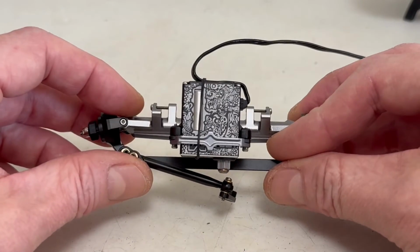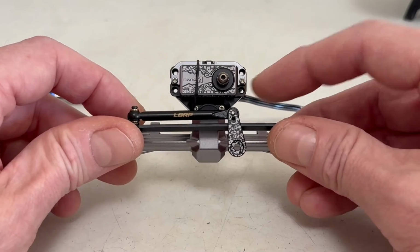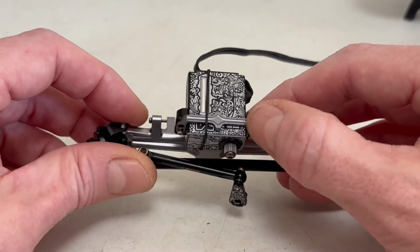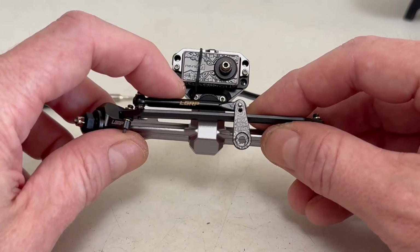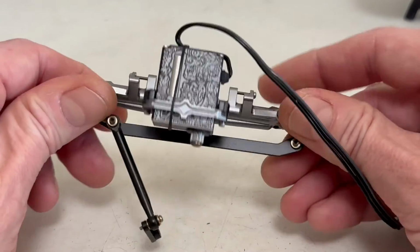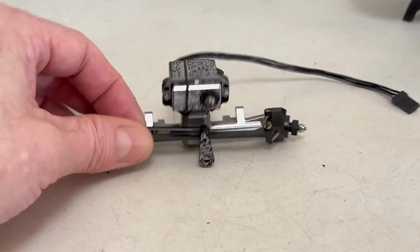And then you can see I got the servo on there, and the little bracket actually acts as your washer, so you don't need any washers. So that's kind of nice. This will have to kind of loosen up and come off to slip under the rubber bands when we get to that point. But other than that, I had to use a piece of double side under that tray as my shim. But everything is nice and smooth, greased up. So that does it for the front axle.